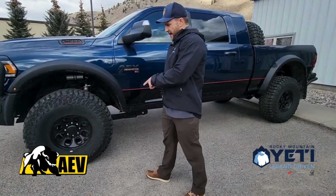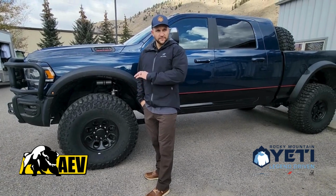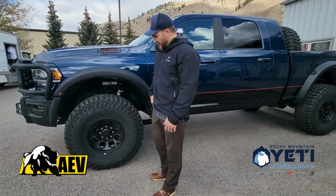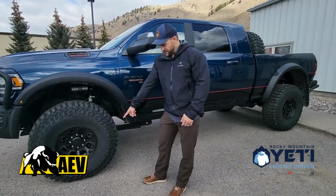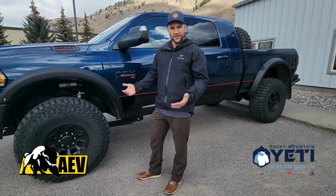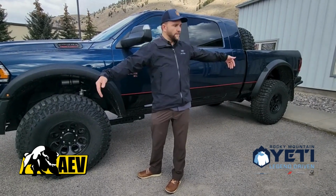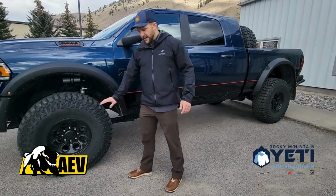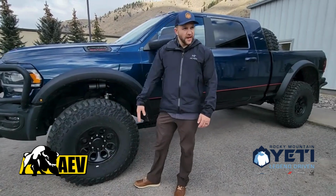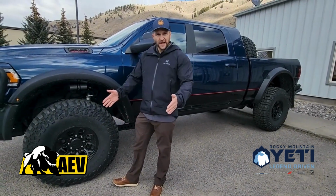The other advantage to that is when you off-road, okay? When you're off-roading, the basics of off-roading 101 is dropping your tire pressure, right? So you drop your tire pressure, it expands your footprint on the ground, it gives you a larger contact patch on the ground, which improves traction. So, like if you think of a tank, those things go anywhere because they've got freaking 40 feet of contact on the ground. Same idea here. Getting you a 17-inch wheel means you can drop your tire pressure down to 15, 12 psi, and you get a larger contact patch on the ground.